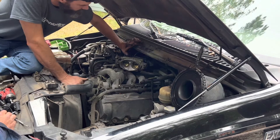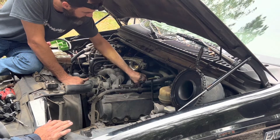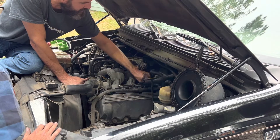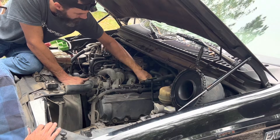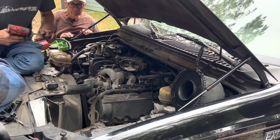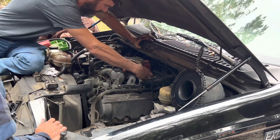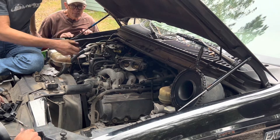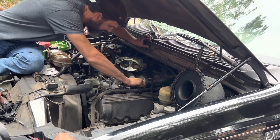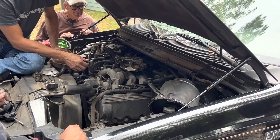All the other ones were showing 0% misfire. What you doing, Steve — you coming to build some walls? Well, I thought we were going to work on that. We are, I didn't know how long this would take. This is the last coil pack I'm putting in. I had new generic coil packs I put in here 20,000 miles ago. He got me hooked up with software and a little scanner, and we just drove it and four of them are misfiring. That will make it kind of run rough — absolutely.